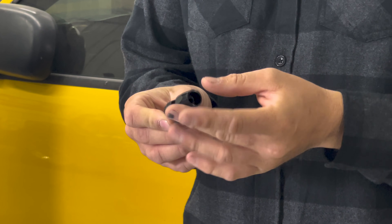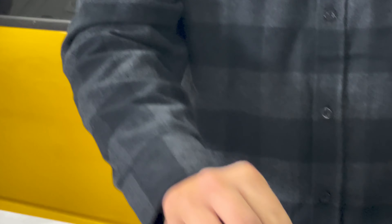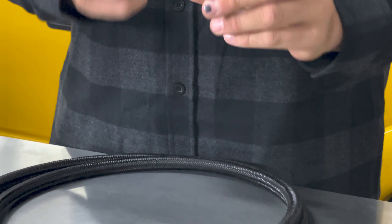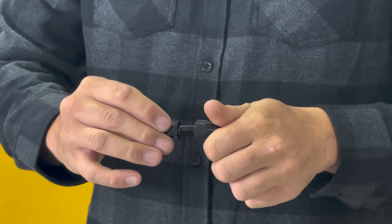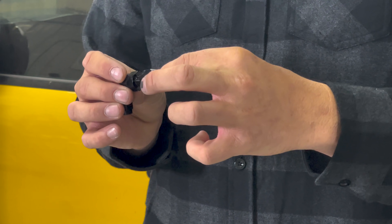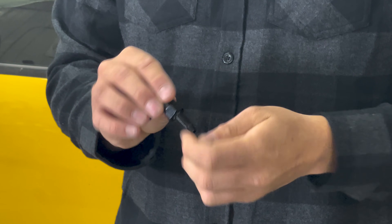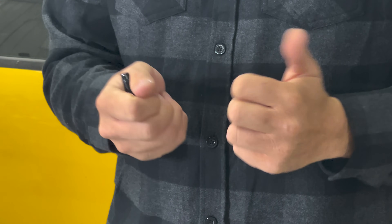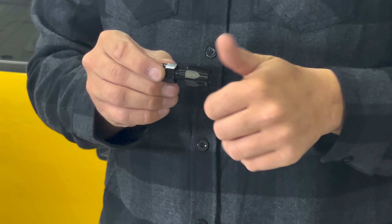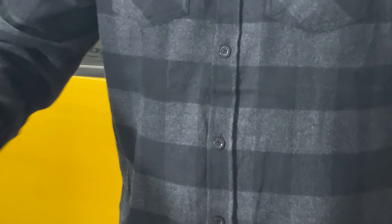You basically have a B nut — this piece here that I'm unscrewing. After you cut the line to length, you slide the B nut over the end of the fuel line, and once it's bottomed out, you screw the fitting right in. What that does is wedge the fuel line between the ID of the B nut and the OD of the threaded section, which has a wedge — and that captures your fuel line. Pretty simple. This is a standard AN style fitting. If this is your first project, it doesn't get any easier than this.